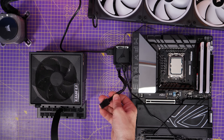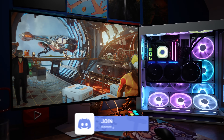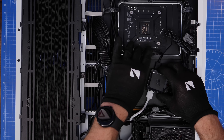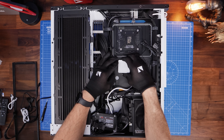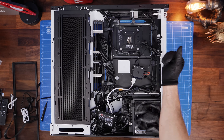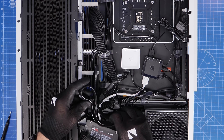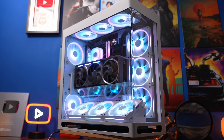This is food for thought, because you might also need PCIe power for your graphics card if you're not using an NVIDIA 50 series or 40 series GPU. In the build I did, I actually ended up needing two of those Corsair iCUE Link controllers — one for the all-in-one cooler and the additional fans — and because of the case layout I had to use a second controller. In theory you could have gotten away with one, but I ended up needing two, meaning two PCIe power cables just for these controllers plus an additional one for the motherboard. That means the MSI power supply I showed you would not work with this setup — you can see me using the Lian Li Edge power supply instead.